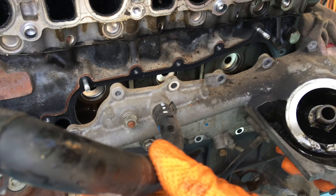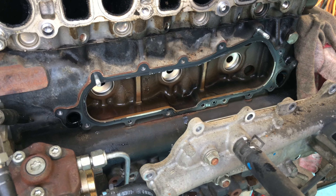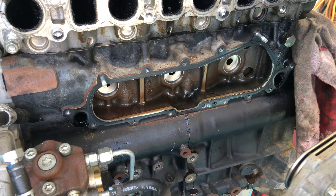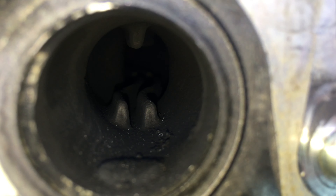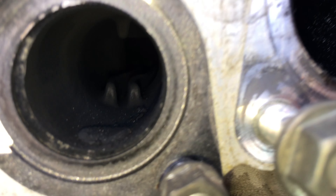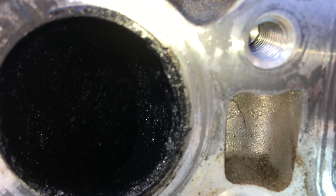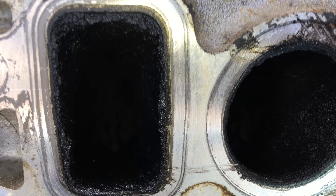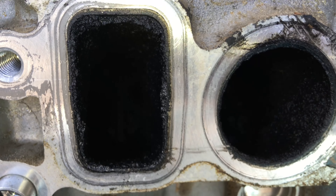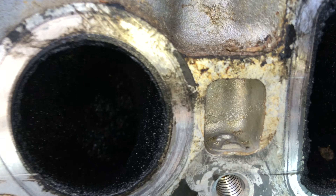The oil cooler is off. And a new gasket to go on the other end. Here's the pan - this is the old one. That's your water - water's clean, no problem. That's your EGR port. Notice it's not caked up because it's dry exhaust gases - it's not oil. Your intake has a slight amount of oil from the crankcase ventilation system. But it makes the exhaust - all the crap from your dirty, flogged injectors that aren't burning clean - makes the soot.